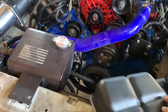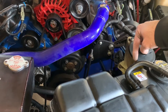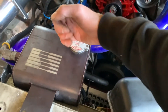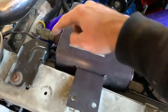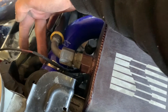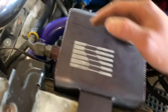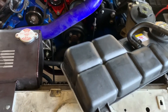It takes a little elbow grease, but once you unmount the radiator fan from this side, you can tuck it up against the engine block and then pull toward the battery. That allows you to work around the radiator upper hose that's blocking part of the radiator fan. Once you do that, you can pretty much pull it right out.